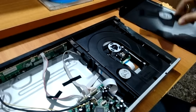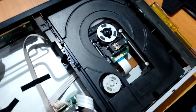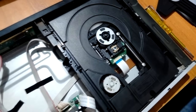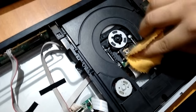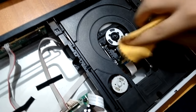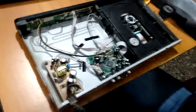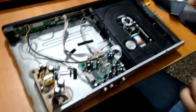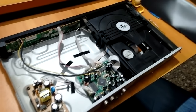Let's lift it up. Now you can see this is the laser beam — the laser LED — which we have to wipe. Take a cloth and wipe it. Don't put extra force; wipe it lightly across the assembly. I'll clean this as well. Now I'll put it all back together, screw it, and then check whether it's working or not.